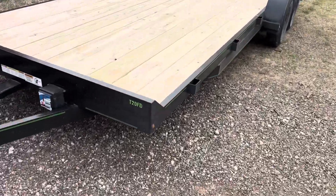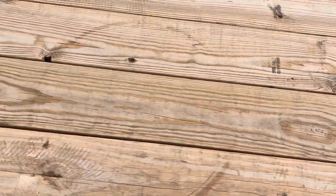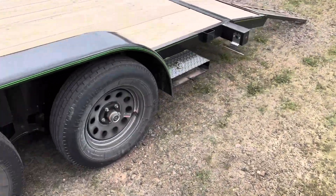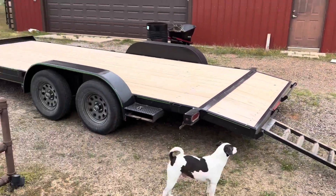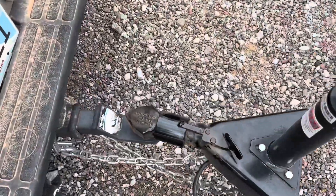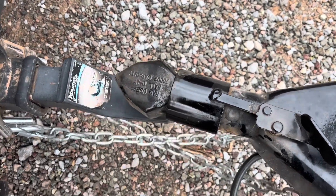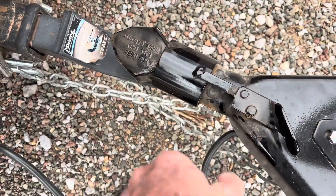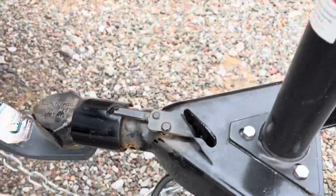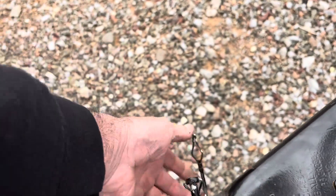I also want to do some tie-downs. I don't know if I'm going to get some of those track-style ones, but I definitely want to attach to the metal because I don't want to just attach to the wood. One of the things this trailer has is called a bulldog hitch — it's this style hitch rather than one of those ones that has the flip-down latch. To open it, you flip this way and it releases. To close it, you plop it in and it automatically closes with a pin right there, just like any other hitch, so it keeps it from opening.